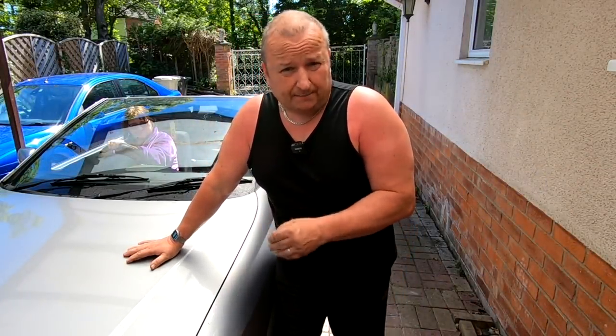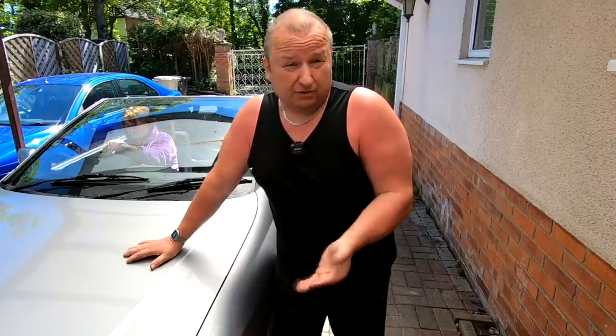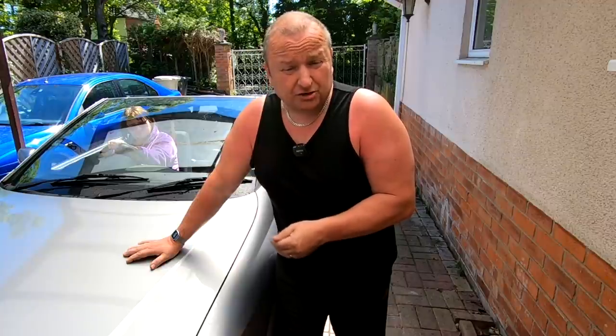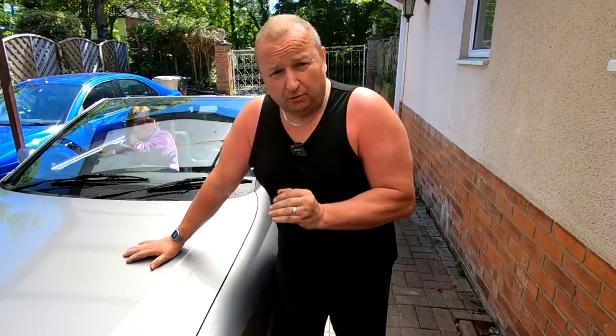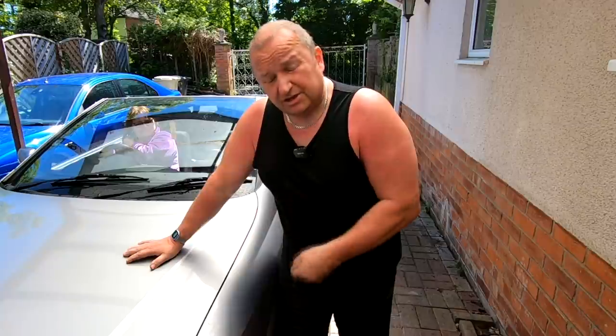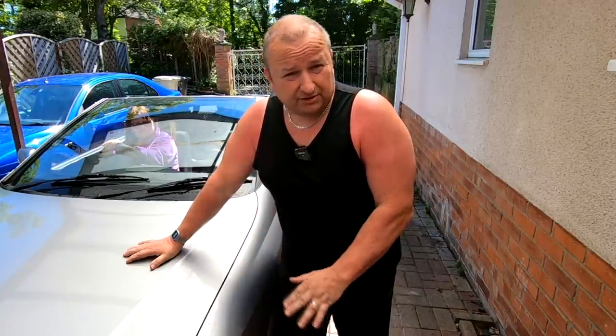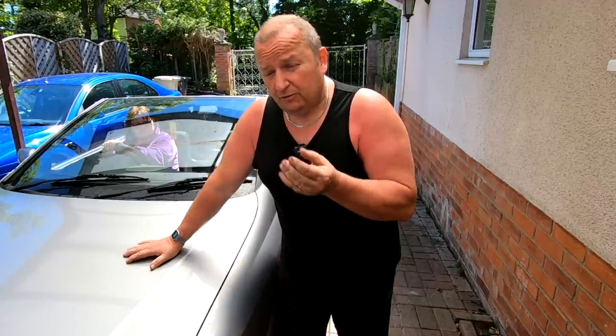I think it's wise to take that bottle out. I haven't got time to do that today, but I thought I'd just show you that. At least you can see that you can take the actual pump out itself and change the pump if you have got a faulty pump. I will take that bottle out, which means taking the wheel off, taking the inner liner out and getting the bottle out properly, and maybe even loosening the bumper off this side just to clean that bottle out correctly, because that filter was totally blocked up.